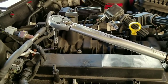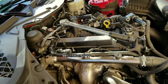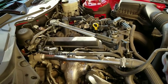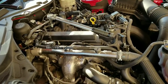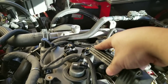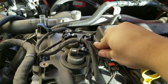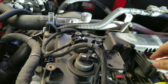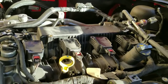You're done installing the spark plugs — now you just gotta reverse the process. Before installing the engine cover I would start up the car, make sure you don't get any errors, and make sure the car is running good. I already put in the other three. They're easy — just reverse the process. Make sure you're going in straight, in the correct orientation. Push it in and make sure they're all nice and in there, then install the screws.